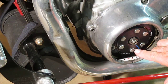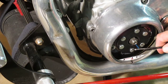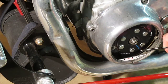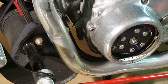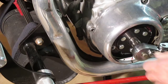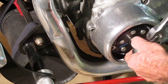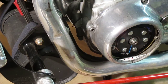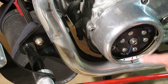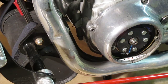Split the difference between that edge mark and here, and that's your top dead center. You can see it's hit on this side. Now if I spin it back around — it doesn't matter which way you spin it for finding top dead center, but you only want to go counterclockwise when doing your timing. See, I've hit it again and that mark comes back right to the same spot. When I split the difference, I know exactly where my top dead center is — exactly the middle of those two spots.